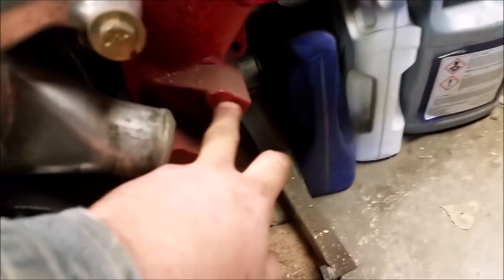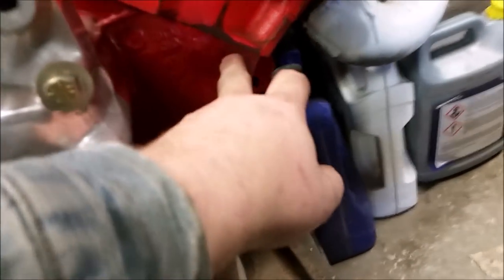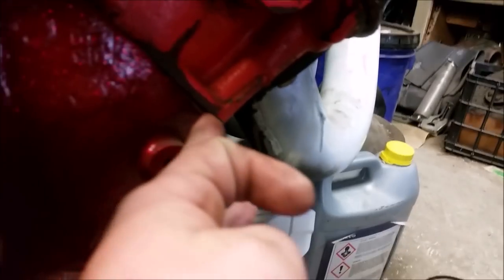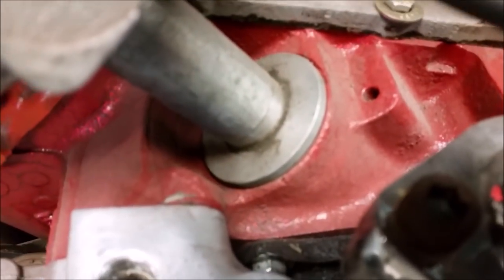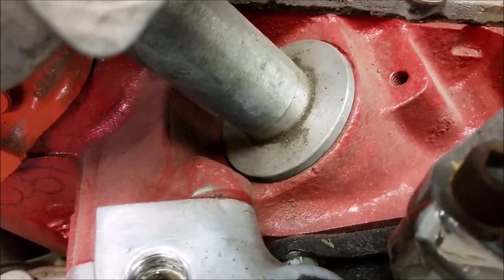We can take this on over to my 440 block that my Hemi heads are sitting on and just give you a little tidbit. So you can see here, this is the same side on a 440 block. Oil pump sticks out, and you can see here where this Hemi head has a bolt that goes through here, and how on the Hemi block it goes all the way down. And you see where the distributor mounts, it's rather bare where the Hemi's is. So yeah, there are a number of differences between a 440 and a Hemi.